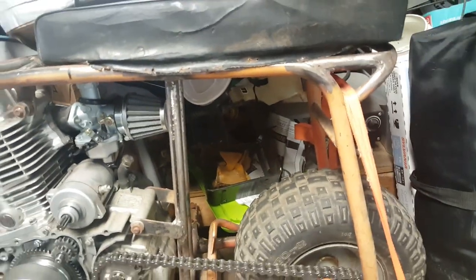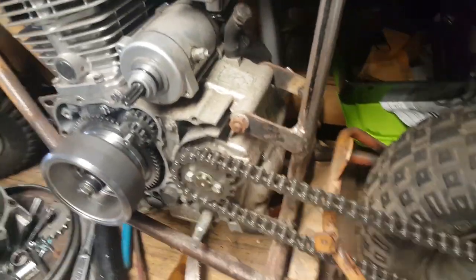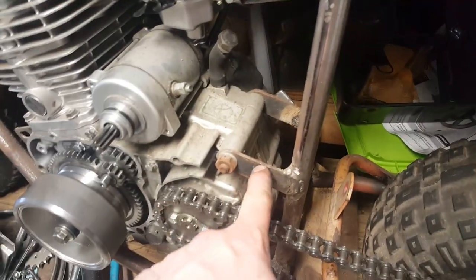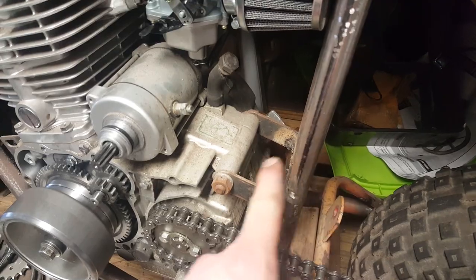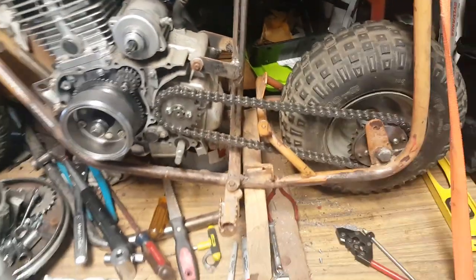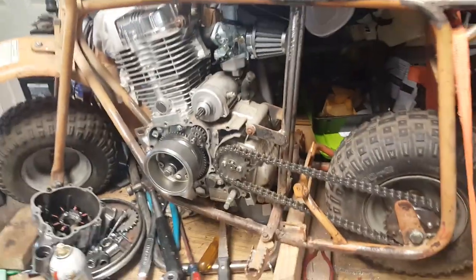Once I get the fender figured out I'll build a little battery shelf and get that going in there too. I also might reinforce the brackets that hold the motor in — I have a feeling it's going to vibrate enough that these are going to break off, especially the long ones. This long bracket here might crack, so what I might do is run another one and triangulate it to the frame. I might actually run it downwards behind the chain so it's prettier rather than out in the open.